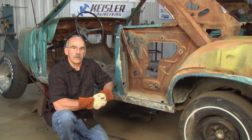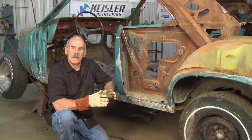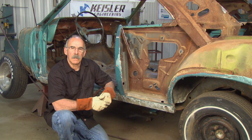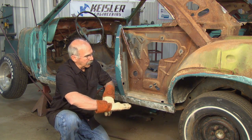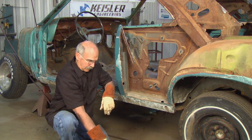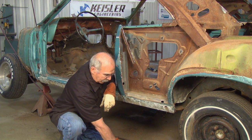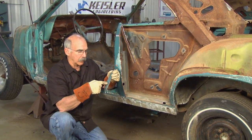I've been thinking about chisel tips — what makes it easier to get a spot weld out in some areas and harder in others. The spot welds are put in at the factory and they usually use a flange. The quarter panel comes down and flanges into the car and welds on top of the rocker — that makes a very strong joint. What I like to do is take off the metal so I wind up with one single plane of metal to get the spot welds out.